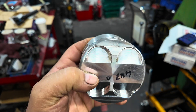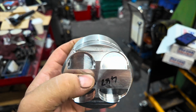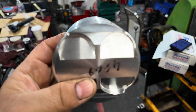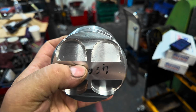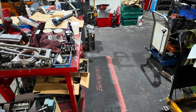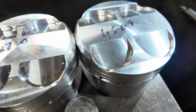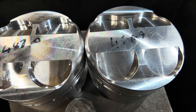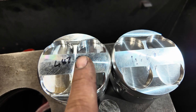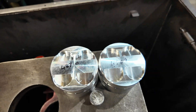This is one of the standard Millington pistons - this is the exhaust cutout. And then you can see how much further back these come because I've dropped that by 1.1mm. If I put them together it might show it even better. The modified one, as you can see, just goes back slightly more, and that's because I've dropped it down 1.1 millimeters. I'll modify the other three pistons, deburr them, and then they're ready for Paul to collect so he can get on and build his engine ready for next week.